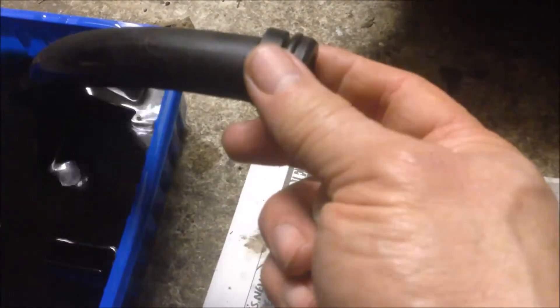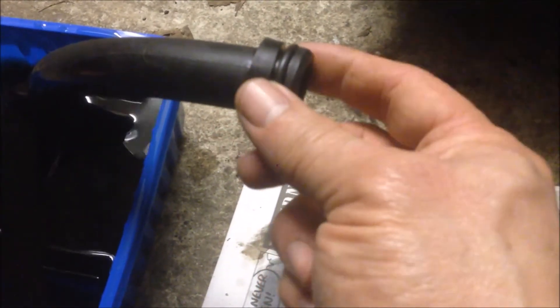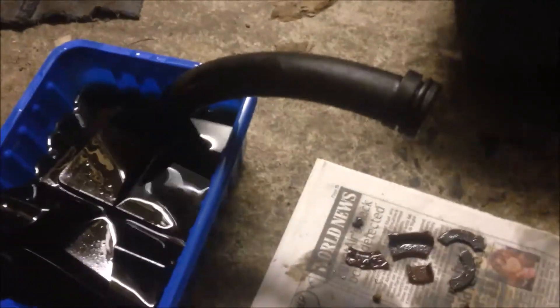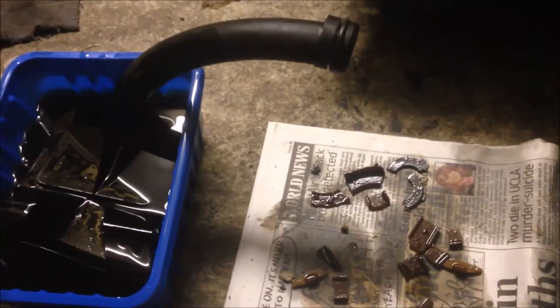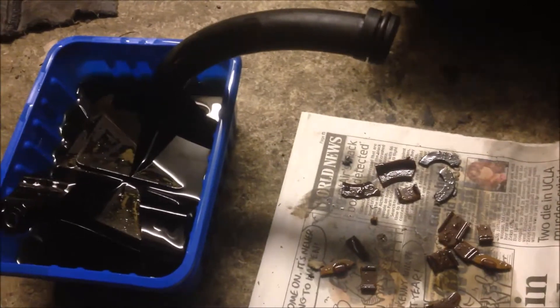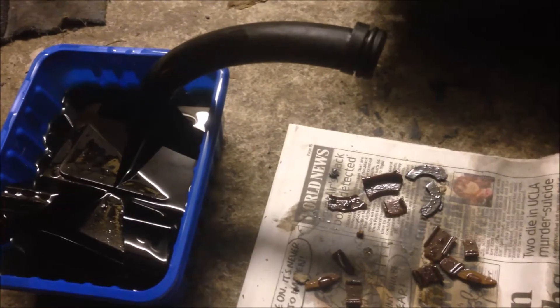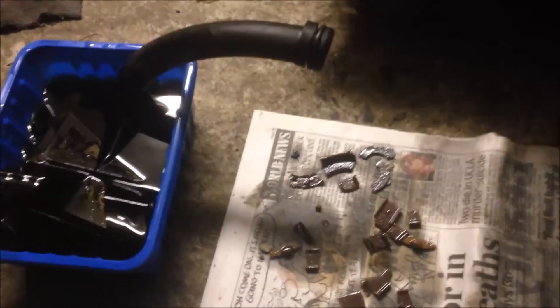I also found that this side at the oil pump is very, very loose — nearly dropping off. I think the 18 pieces of plastic inside the strainer, along with this very loose connection, will contribute to my oil pressure problem. When I cold start the car, it takes about 20 seconds for the oil pressure indicator to go off — that's low oil pressure.